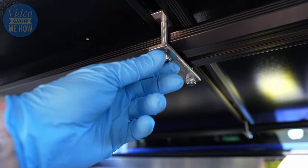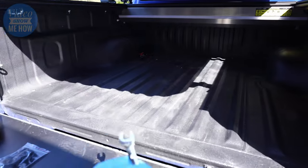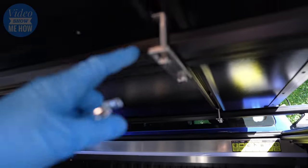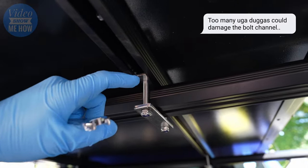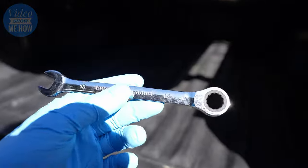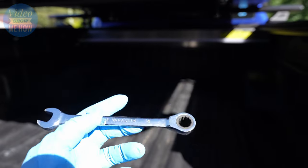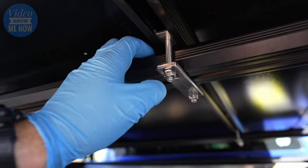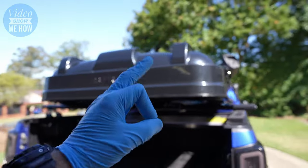There we go — it should look a little bit like this. Now it's just a matter of cinching these together and tightening down. Conveniently we have the included ratchet spanner. I'd recommend using this rather than a rattle gun — you don't want to apply too much force to the brackets. They are strong but don't go crazy and strip things out. Just do it by hand, jump underneath, and tighten all these down. It's recommended: regular tight, not maniac tight. One, two, three, four — all bolted down. Give it a good shake — whole car moves — perfect.